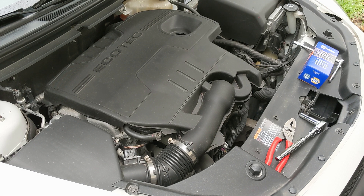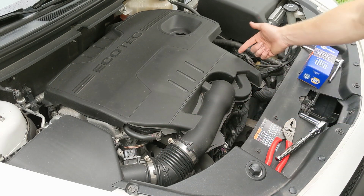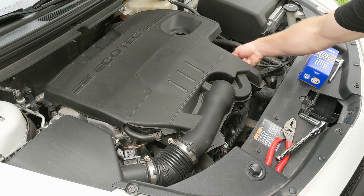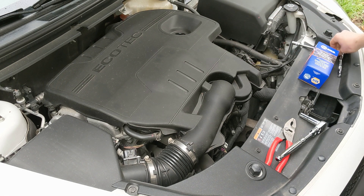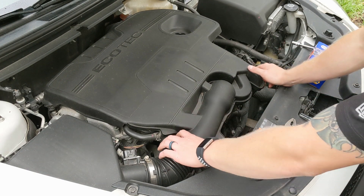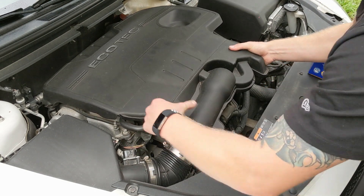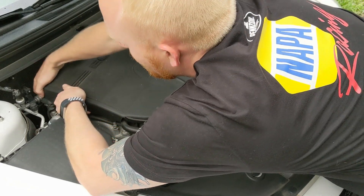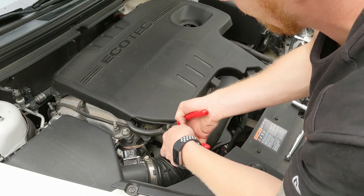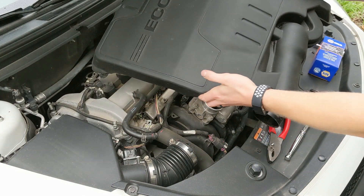What you're going to need is a ratchet and an eight millimeter or flathead screwdriver to loosen the clamp on your filter. I disconnected my MAF. Inside of here, you're just going to run your ratchet and extension — there's a fastener and clamp right inside here. Basically just a coupler from this plastic shroud to the hose to a coupler that goes to your engine. Once you've removed those two, remove it and remove your oil cap. You're going to have this hose right here, so be careful of that, and there are just a couple rubber bushing mounts back here that you push up on. You can take a pair of pliers to remove that, and there's the top — comes off super easy.